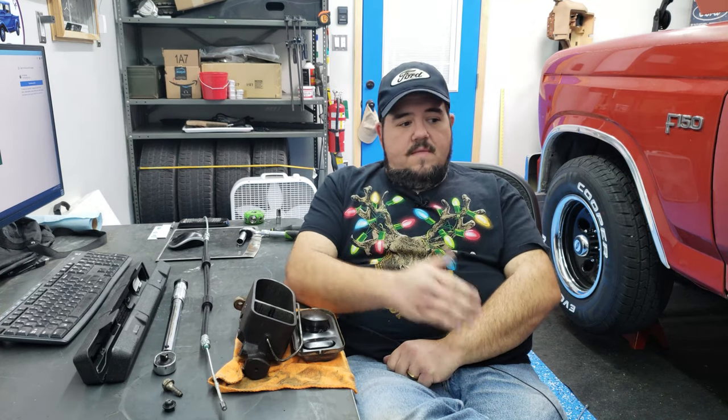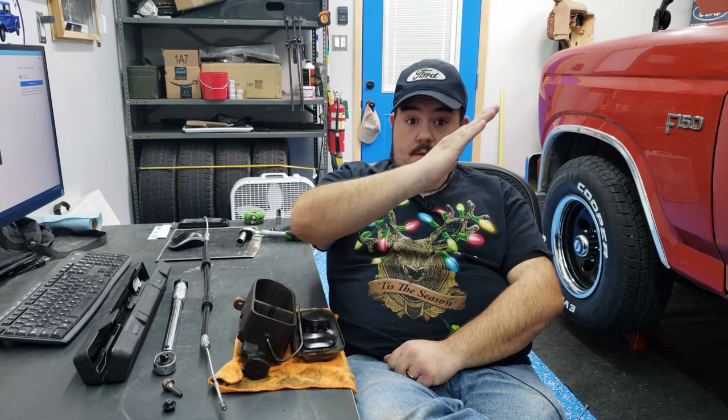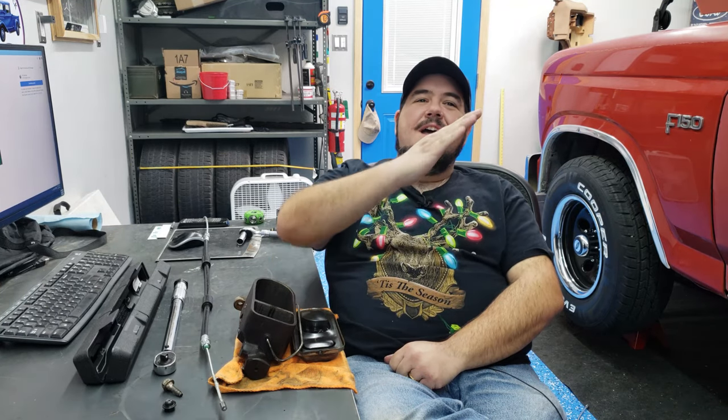And then I went to try the parking brake and try to get the truck to stop on a hill. So the truck stopped on the hill with the parking brake held, going both forward and backward the first time. And on subsequent attempts, I checked the parking brake with the truck parked facing up a hill, so rolling backward. Because of the way drum brakes are designed, it's actually the harder direction to stop a vehicle, because of the rotation and the way the drum shoes are. So holding a vehicle facing backwards on a hill is harder.